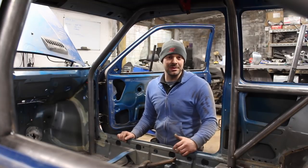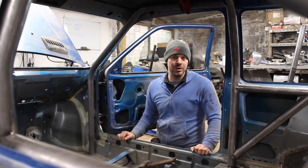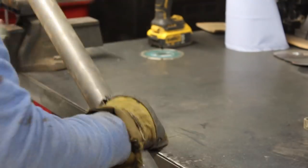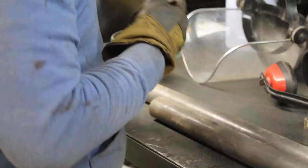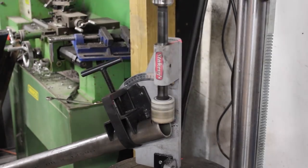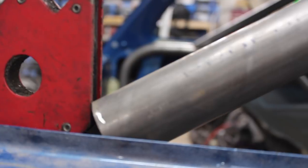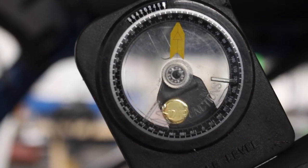I can't make the plinth today because I've run out of 4mm plate. I can however make the other main hoop backstay. Taking measurements from the completed backstay, I cut to length and notch one end of the tube. MSA Blue Book Section K stipulates a minimum of 30 degree angle on the backstays. I've achieved 32.5 degrees on the finished side, and when the lower end is notched, this side should come into line.